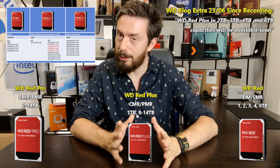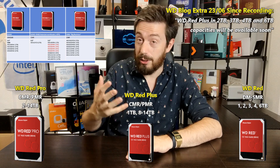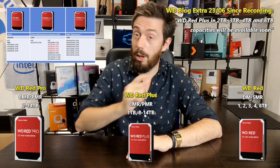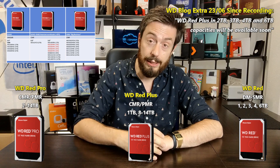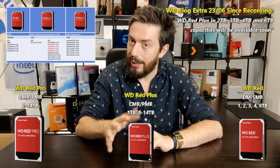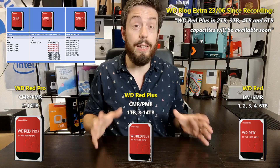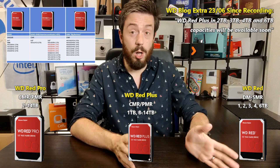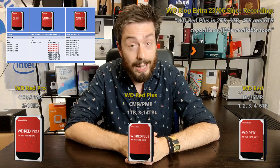What do you guys think about this differentiation? I think it's a good idea to separate between them, but I don't think it's extreme enough. A lot of those WD Red SMR drives have been pulled from many NAS brands' compatibility lists — that's something we've known about for a while. They're still usable drives, but you wouldn't do that unless you were a little unconfident within the RAID environment for your consumer's data. Let me know what you think — is this smart or not? Click like, click subscribe, and I'll see you next time.